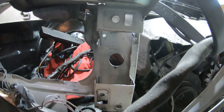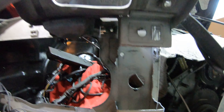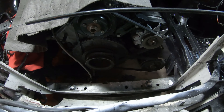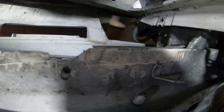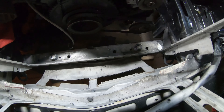So here's what we cut out so far — a square right there, cut out the top little bracket for the headlight holder, same on this side here. The intercooler fits in but it's sticking out a little bit, slightly tilted towards the front, so I've kind of outlined a little square right there and the same on that side over there. We're going to give that a cut, put the intercooler back in, and see how it's looking from there.